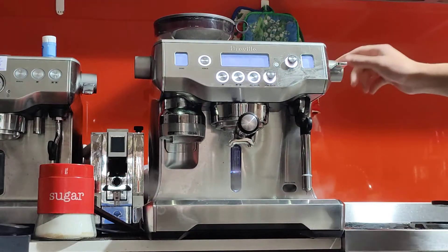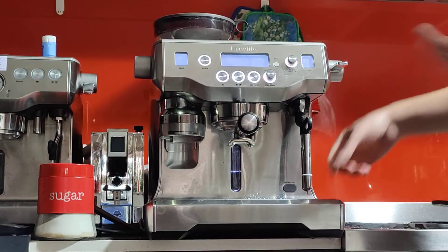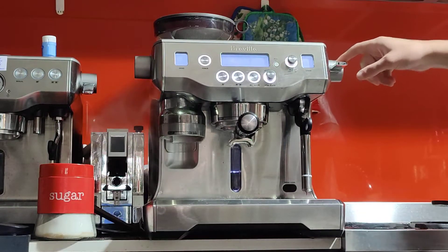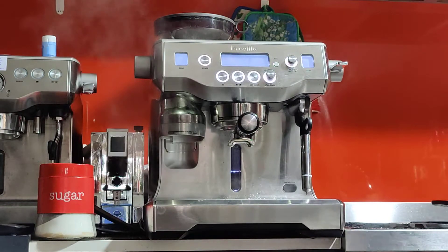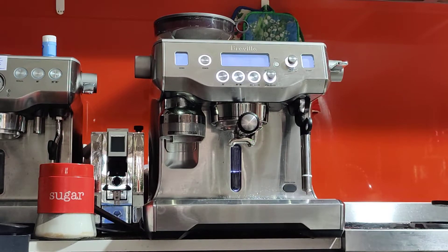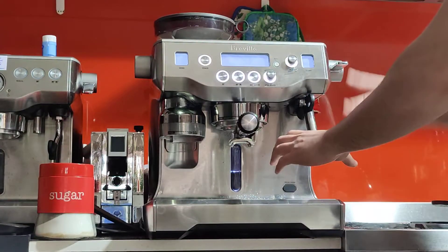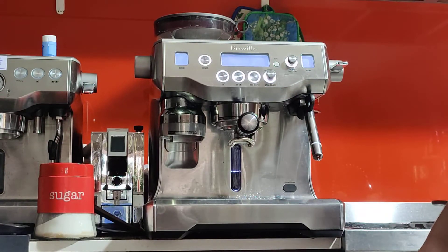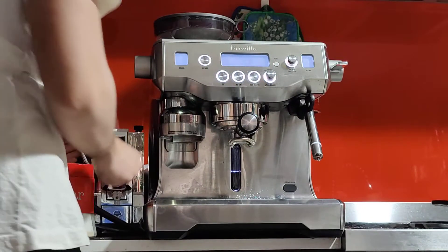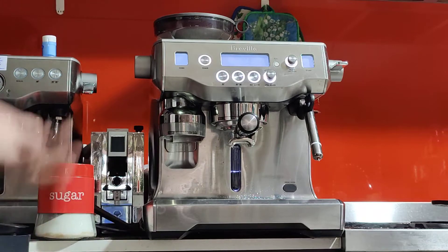Steam works — there are no issues with the actual steam output. It's just that the air pump has trouble putting air into the milk on the automatic setting. If I press the automatic setting and make my milk automatically, even with maximum froth it's still fairly flat — flat milk without a lot of foam. So you push the lever up to use the manual mode, just like a barista on a manual machine in a café, and froth it manually. That works just as well; it's just less automated, which is why it's been significantly discounted.